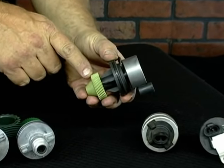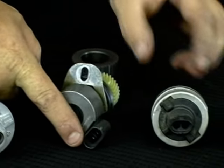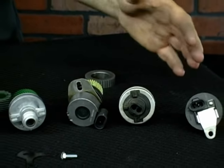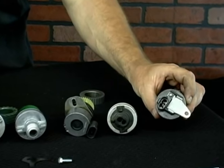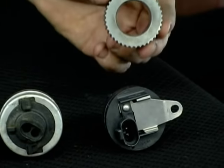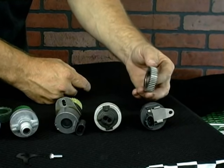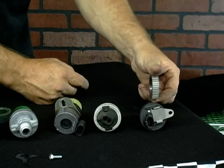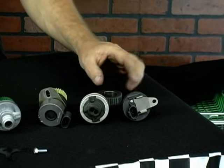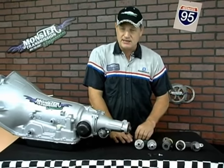This digital style was mechanical on one side, went through a receiver hub, and came out with either a flat spade electronic connector, a two-wire connector, or a round connector. Both styles were available in some late GM vehicles. Then in 1992 and later, most went to what's called a VSS — Vehicle Speed Sensor. It's a magnetic pickup with a 40-tooth gear on the output shaft in the same two-hole location. The gear rotates past the vehicle speed sensor, and that pulse tells the computer what speed you're traveling. This setup is available on 1992 and newer 700R4s.